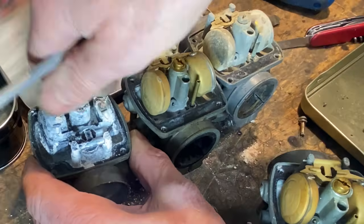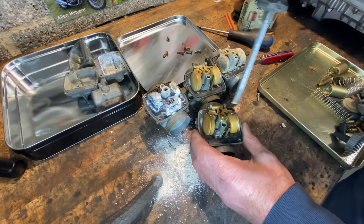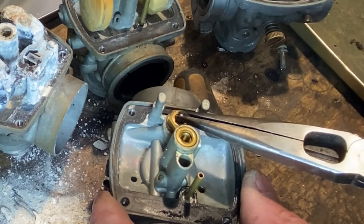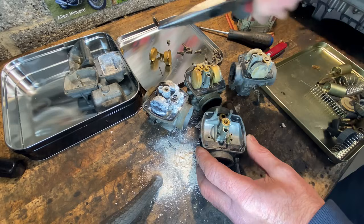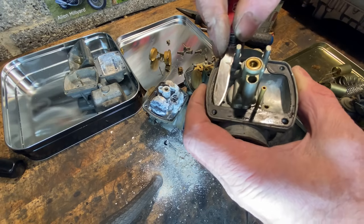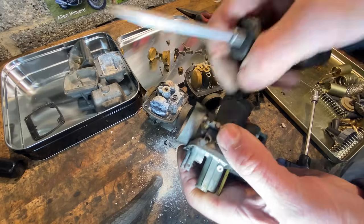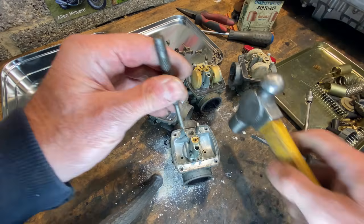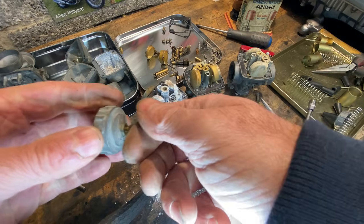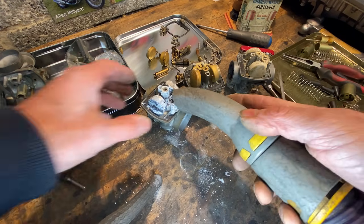With the float bowls removed, I start stripping down the carburettors — first removing the main jets, then the floats. I decide to strip the cleanest carburettor first. Even the fuel cutoff valve was mint — I think this carburettor would just work if I put it on the engine — but it's best to strip it down to clean it just to make sure. The gasket is really hard and brittle, but I'll be making new ones. The tickover screw and pilot air screw unscrew from the body, and the last thing I need to do is tap out the needle jet. With the first carburettor stripped, I use my garage vacuum cleaner to suck up all that powdery mess — don't ever be tempted to use the one out of the house, it'll make it proper smell.